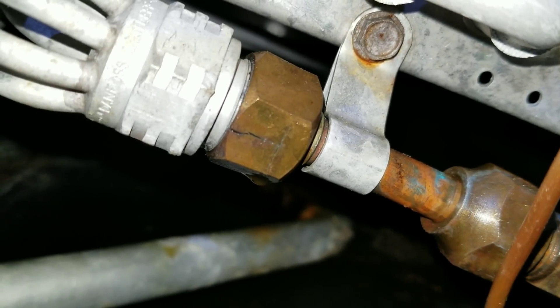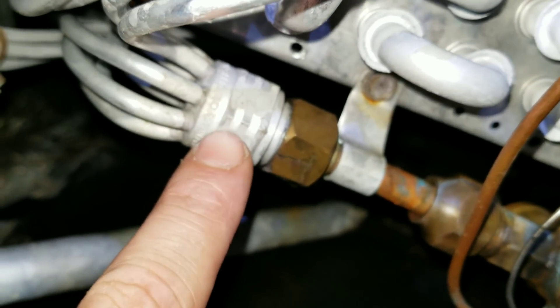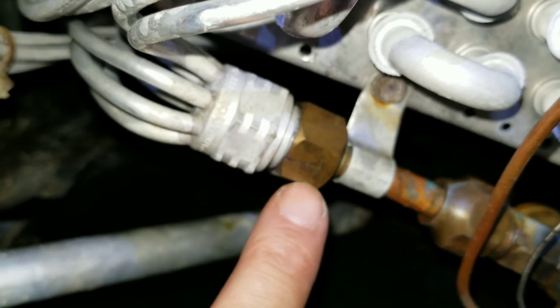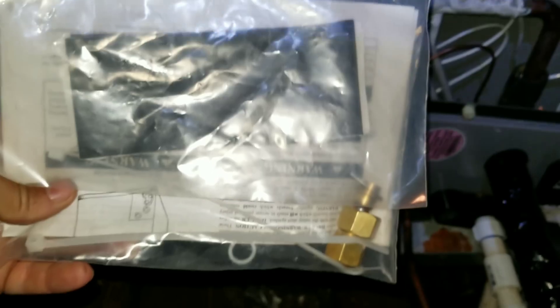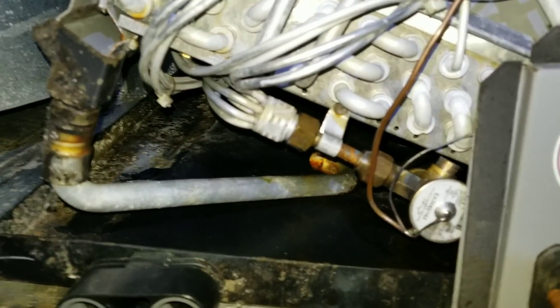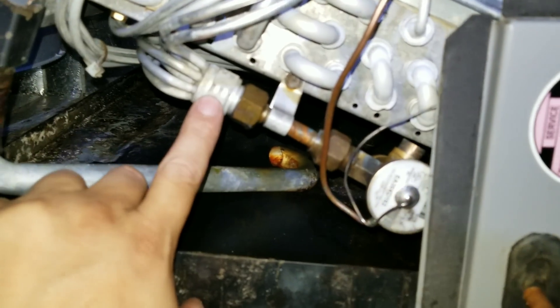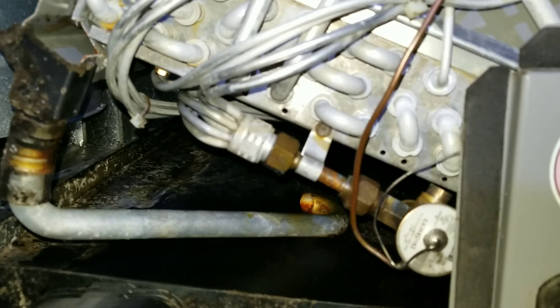That shoulder nut is split wide open. So I'm wondering if there was something wrong here — they didn't have the retainer inside. Sometimes they have two retainers because they forget to remove the old one, or whatever the case is. So I'm gonna break that apart. Thankfully I'm a pack rat and I had a spare on the truck, so I'm gonna go ahead and break that apart and see if I can get that changed out and see what the problem was. Hopefully that distributor head right there isn't damaged, but let's break it open and see what it looks like inside.